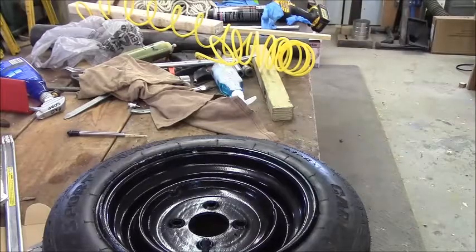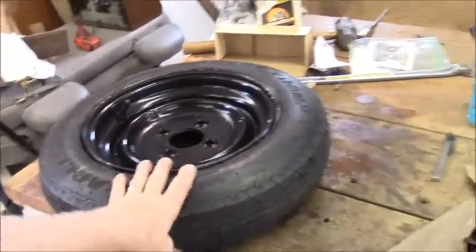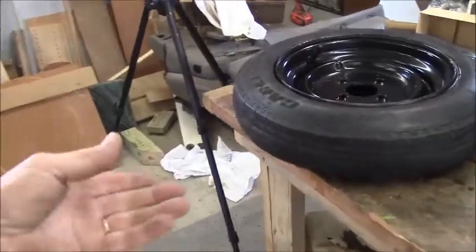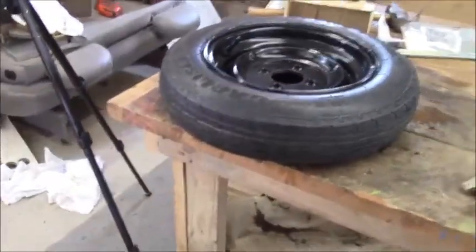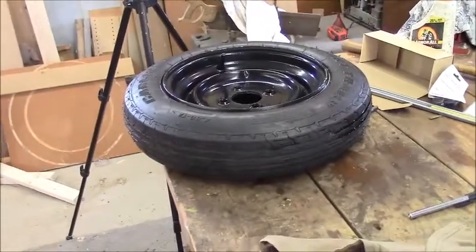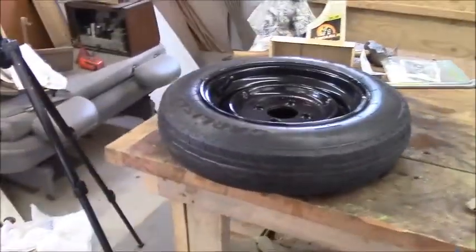That's all there is with that little fiasco. I'm surprised that both beads went on at once - that was kind of cool in a strange sort of way. I just want to make one comment about how we seated the bead. I've always tried to use ratchet straps, but I think because they're wider they want to just press the tire in. I think actually the rope being almost a single point contact around the tire, and then using a tourniquet method, is actually the reason it expands. So I'm definitely going to have to try a rope and tourniquet on my next tires versus blowing them on with explosive liquids. Alright guys, God bless, take care, we'll see you next time.